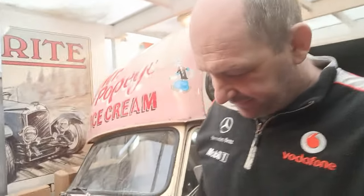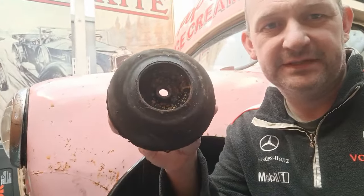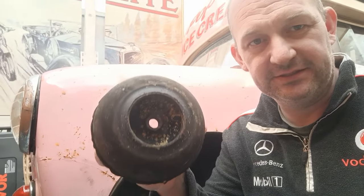So this is where I'm going to recap over all the things you missed when the GoPro broke. First up, I wanted to get the rubber cones out - they were corroded inside. My spring compressor just wouldn't bite into it - it was imperial and wouldn't touch. So I ended up having to cut the trumpets to drop them out, but the job's done and it saves us a lot of swearing.